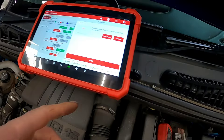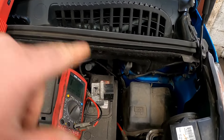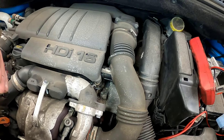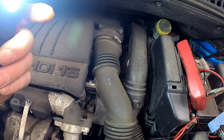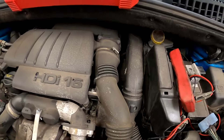Now we can confirm our fault code. We knew the relay was working to start with just by going off the fault codes, but we checked it anyway. And we have got faulty glow plugs. This procedure has taken me probably about 10-15 minutes, because if you were to take all this off down the back just to put your test lamps on the back of the glow plugs, it would have been an hour to an hour and a half's job - horrendous job.